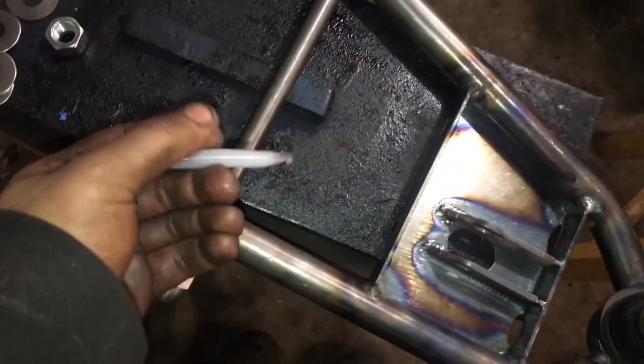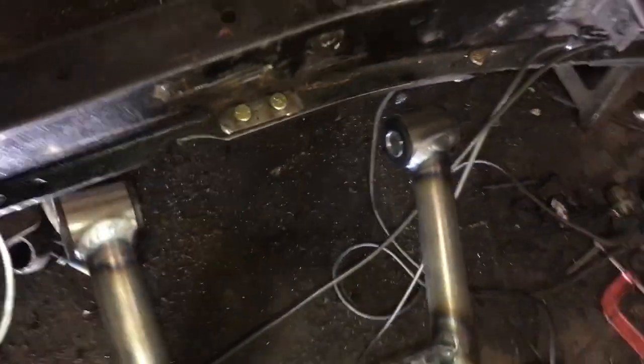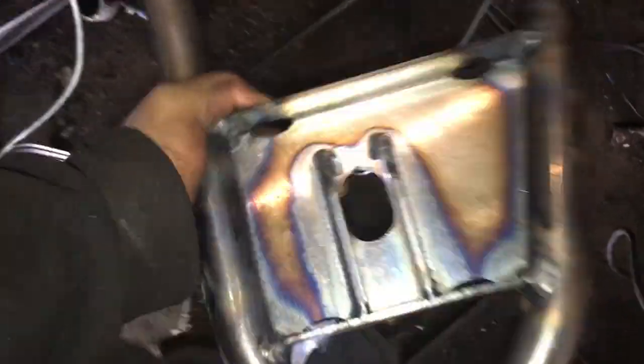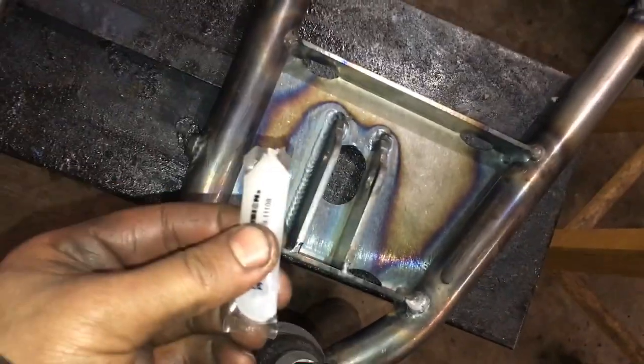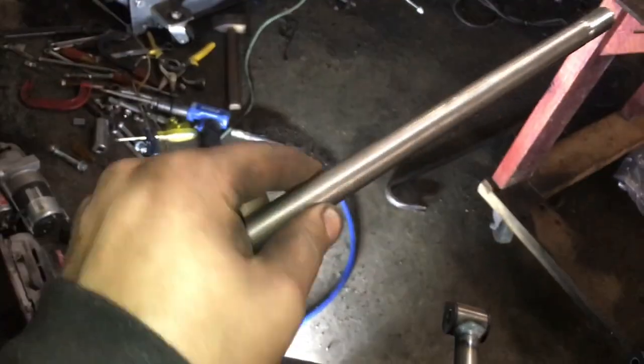TCI was generous enough to include some grease with the kit. Here's how it's going to go in the car — remember we're on the driver's side here. Your flat end is going to go toward the front of the car and the more slanted end goes toward the back. I'm going to grease everything pretty well. I already tried to line this up with the inside of that crossmember bolt — it's a really snug fit. Make sure you lube it up nicely so that if you ever have to do maintenance in the future, it'll actually come out and won't rust in place.